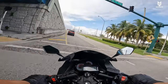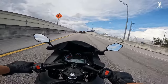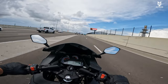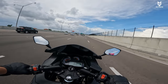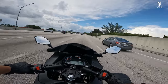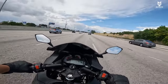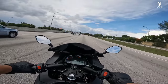As long as you do all that, these bikes are great. Another thing: tire pressure — make sure you go by the recommendation so that you get proper handling. I replaced the rear tire from a 140 by 70 to a 150 by 60 by 17. That gives it a nice aggressive wider look on the tire itself and it also gives better acceleration because the tire is not as round as before — it looks more like a low profile tire.